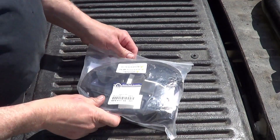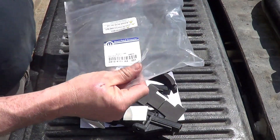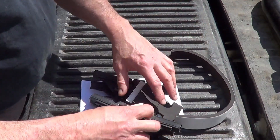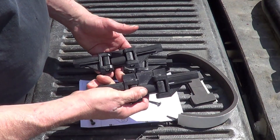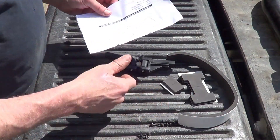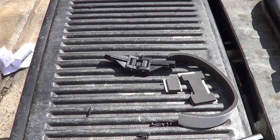So what's in this repair kit? Well, let's take a look. This was about $60. If you shop online you can find it — I got it from my local body shop connection. Again, it's 68194101AA-001. You get a piece of foam tape, some more foam tape, and four hinges. The difference between the hinges: we have ones for the front portion of the cover — they're taller because when you fold the cover up three times you need the height. The short ones are for the back. You also get some screws and instructions, which we don't use. Just kidding.